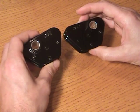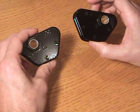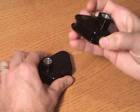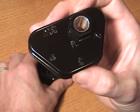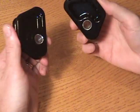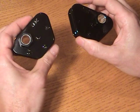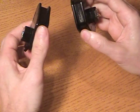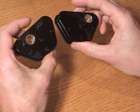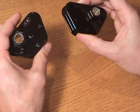Here we have the four-position adjuster blocks. These include the fourth location, offering an overload preset. A lot of guys go out in the morning when trails are nice and easy with minimal bumps, but when you come back, the trails are all rutted up and you're constantly bottoming out your suspension. The fourth location adds a decent amount of force to help prevent bottoming out your sled. If that still becomes a problem, you probably need a spring change, but this definitely helps.